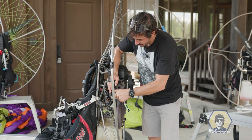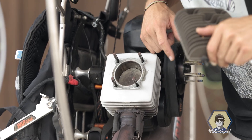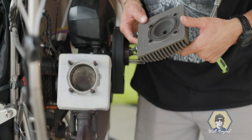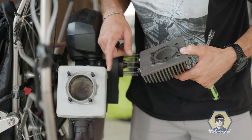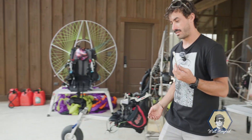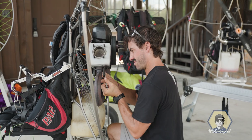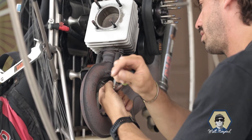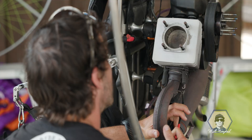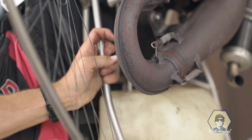I just cracked the seal and it looks really good. There's a slight leak around this o-ring, but overall it didn't leak a bunch of black oil out the side — that's clean, burning clean. O-ring's good. Sure, it blew by a little bit, but it's not anything significant to cause it to burn up. I'm going to use the same wrench, push the exhaust over, and work on pulling the springs. I have a spring puller — that would be a little less work.